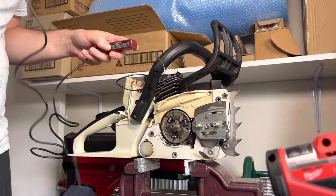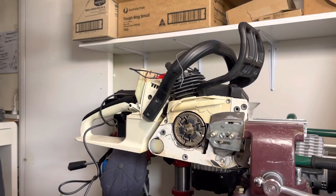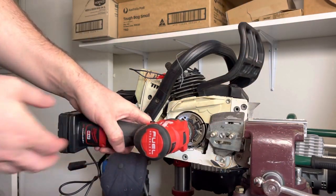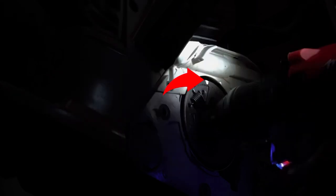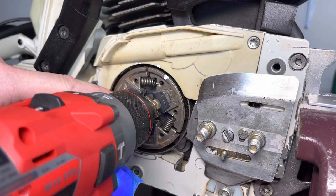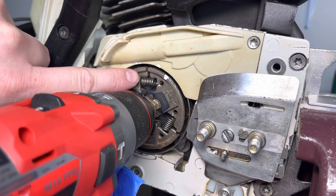Now what we need to do is get our timing light. I'm going to hook this up towards the spark plug on the HT lead. Last thing I need to do is rotate this engine, so I'm going to use the drill on fast speed. I'm going to turn the light off now. We want to see where this white mark lands somewhere around about here on the plastic. As we rotate the drill, this clutch is spinning, and as the engine sparks it will flash and shine up this white mark, giving us the point at which the engine is sparking.